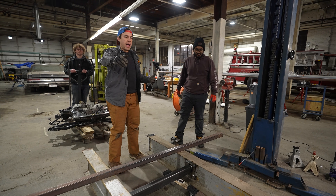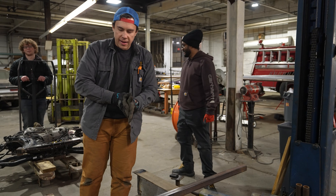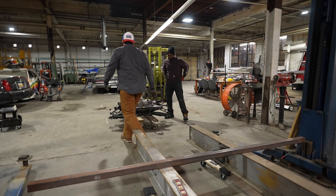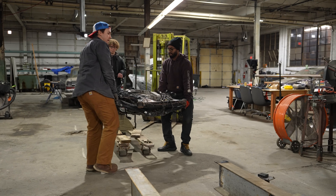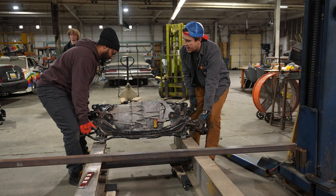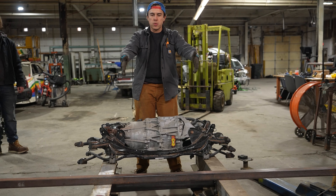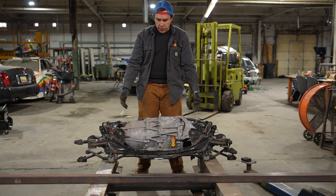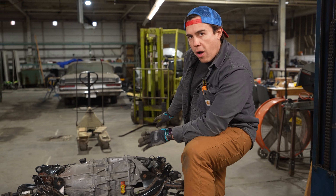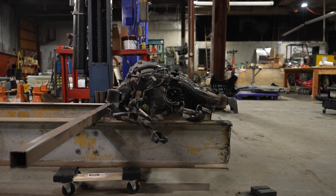This is the length of the K truck. We pulled this beam out of the back, cut it in half, and it is the length of the K truck to the inch. It's cosmic. We put the rear motor unit onto the chassis table. This also is about the width of underneath the K truck — between the tires — and it shows you where our suspension pickup points are going to be. Already I'm happy that we made a flat chassis plate because I can immediately see how far off that subframe is from totally flat. It gives me that datum line — I have to bring those rear points up and flatten those out.